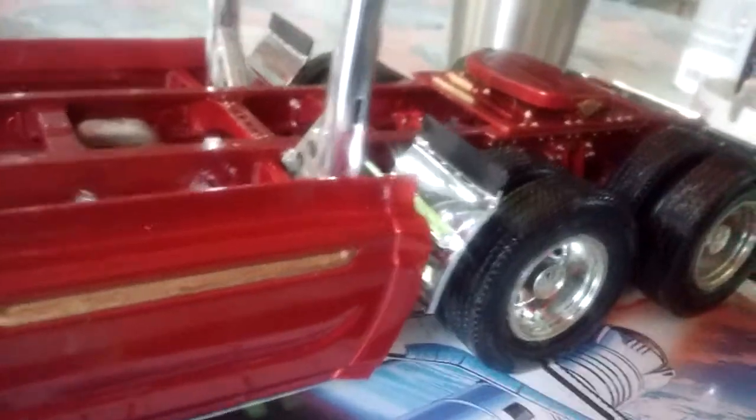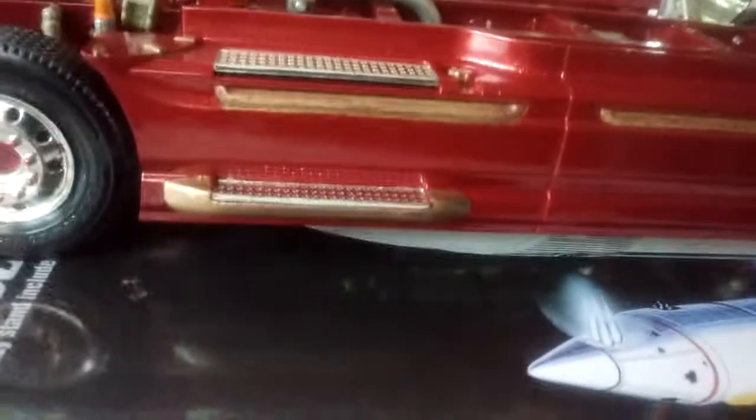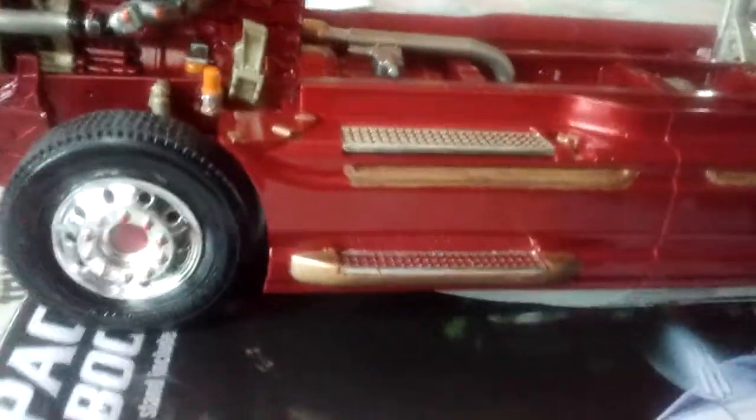I got it just polished and clear coated. I've got two coats of clear on here. I did one coat and I sanded it, then I put another clear coat on, and then I buffed it. As you see, it's a really, really nice paint job. It just turned out phenomenal. Look at how it just shines — you can see all the reflections.